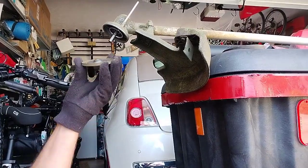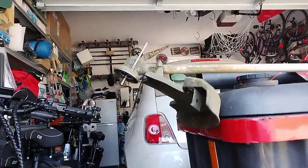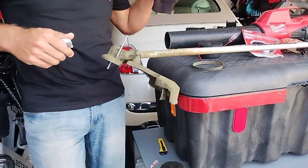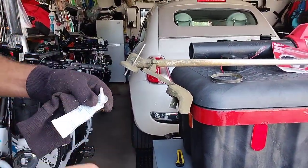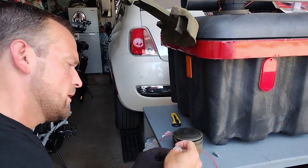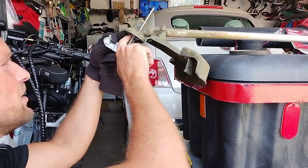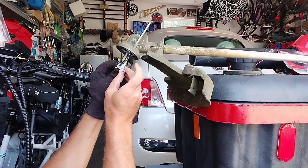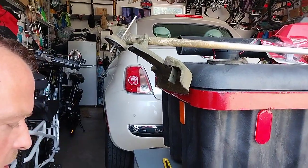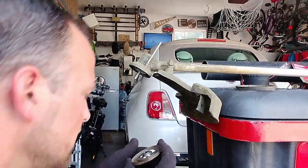You can see that little bit of grease coming in there from the grease porthole — that's supposed to be in there. I'll put a little bit of extra grease in there to keep the metal good. I've got some white lithium grease — I'll squeeze a little bit up into that little screw hole. It has grease that comes down and feeds the spindle a little bit of lubrication. We'll put a little more on this disc just to make sure we're good — keep it lubed up around that spindle. You don't have to do this, but sometimes that porthole can get a little clogged, so just give it a little extra to keep it sweet and happy. Make sure you get that screw back in the way you took it out.